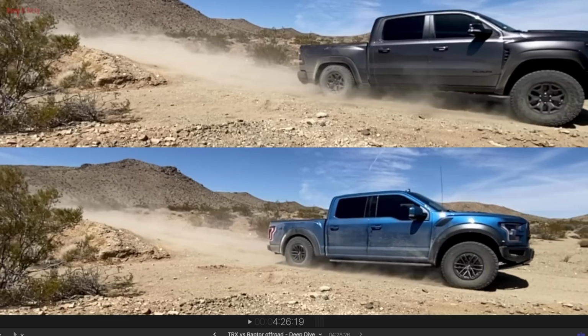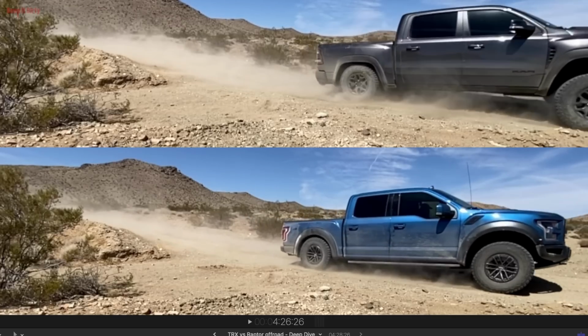And I think that's kind of a good thing. You need to find that sweet spot on rebound. You don't want it to pogo right away, because that's bad. That's gonna just make you fly all over the place and buck and all that stuff. You don't want that. You also don't want it to be too slow that it just hangs there like this did. That's also bad, because what if there was another bump right there? Your suspension's already fully locked in.